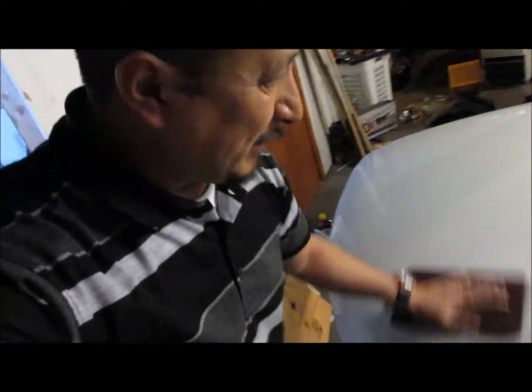I actually wiped all around the perimeter of the edge underneath. I don't plan on painting the hole underneath or taping, but I am gonna hit underneath with the can as I'm going around. It's gonna be gold flake for the whole hood, and in the middle it's gonna say YouTube Trev 23 23. Do not flip this pad unless you have a rubber glove on, and do not lean on this hood because if you lean on it you're gonna put oils into that paint and get a fisheye. You've got to press hard enough to get rid of the shine - paint will not stick to shine. Do it in a crosshatch pattern.